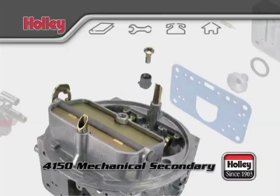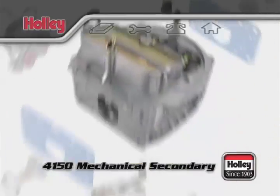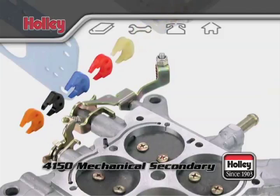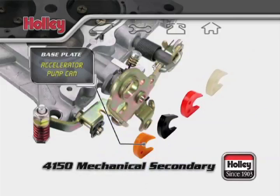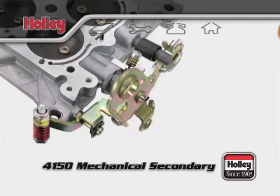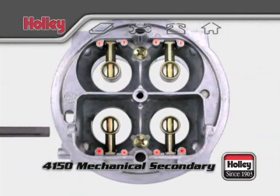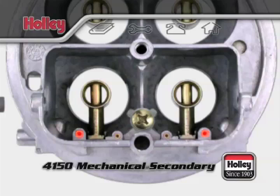The volume and duration of fuel flow through both squirters can be customized with accessory kits. Holley offers different size discharge nozzles for the body, and you can switch to one of many different accelerator pump cam choices. These cams for the front and rear accelerator pumps are changed out on the throttle plate assembly to further tune the system. Back on the body, the front and rear venturis have four small holes that are the air bleeds for the primary idle and main fuel metering systems. The outer two are for the idle circuit, and the inner two are for the main circuit.